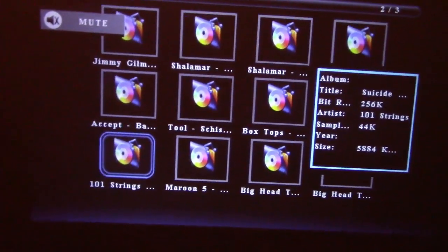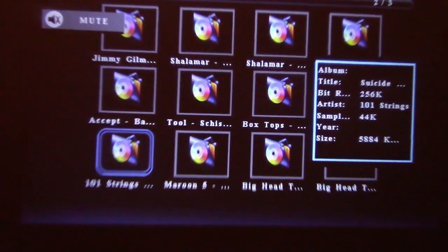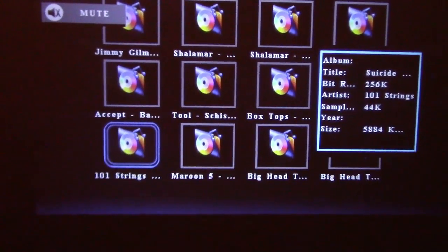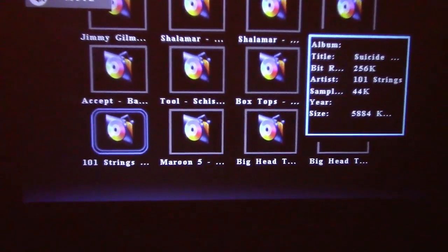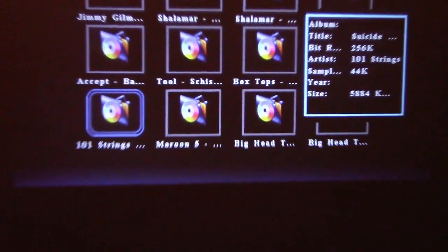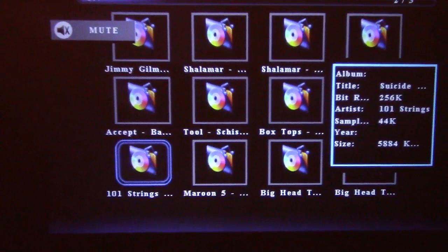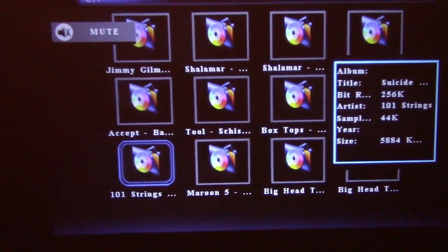Fortunately, I was able to fix the problem with the focus — it was very simple. It was a matter of adjusting the keystone setting. You can see right here where it is. If I move it just like that, everything is in absolutely perfect focus. Now I'll adjust the focus ring to get that really nice and sharp, and everything is displaying in very good focus through and through. If I move it back, it gets blurry at the bottom — but that may just be the tripod not being absolutely straight. By adjusting that, I was able to get it absolutely perfect dialed in.